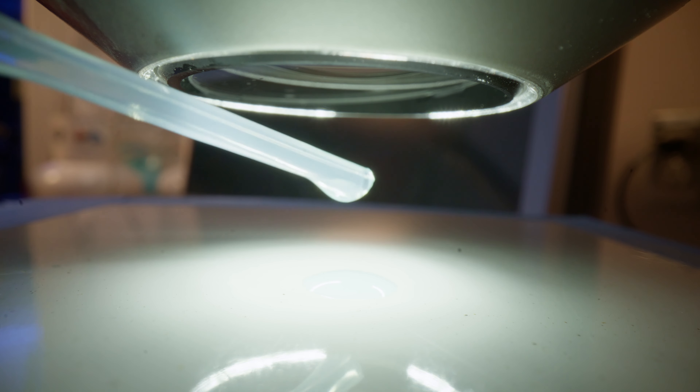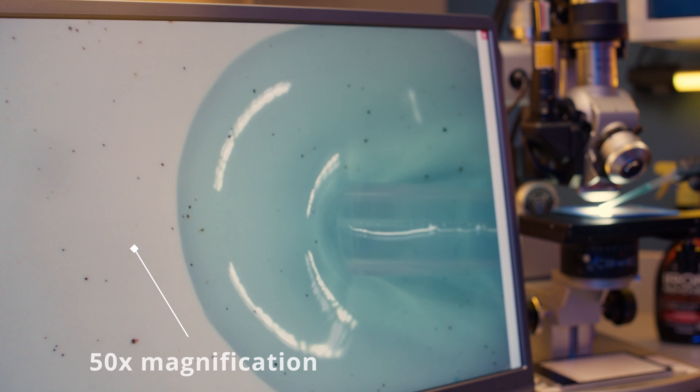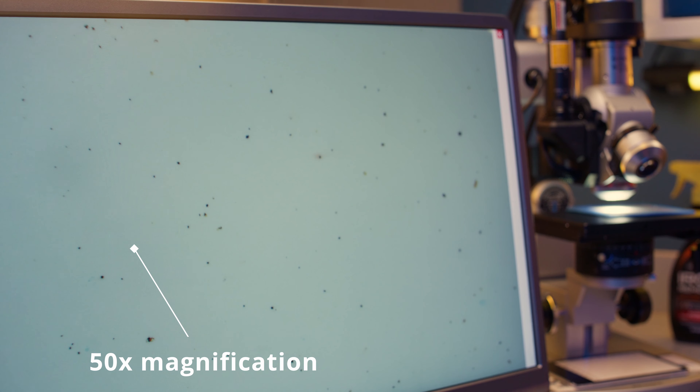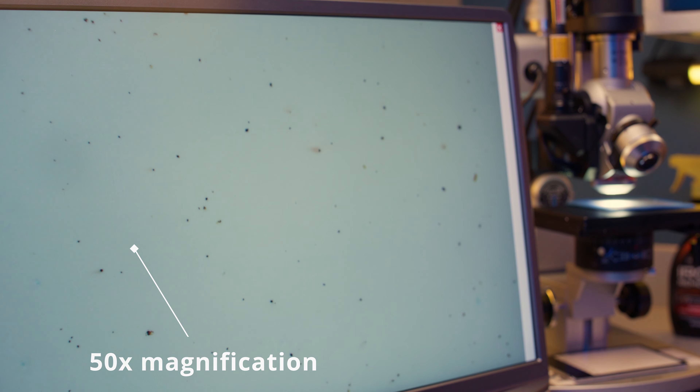For each of the six panels, we're going to be applying the iron remover. Most of the directions on these say a range between three to five minutes, so we're going to give it that full five minutes to give every iron remover a chance of doing its full interaction with the iron particles. After it's had that chance, we're going to rinse it off into still water and reapply the iron remover to see if it's still reacting with any iron particles left over on the surface, or to see if they've all been whisked away.